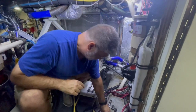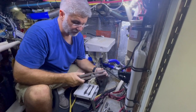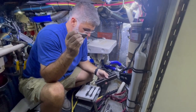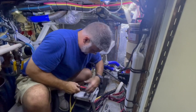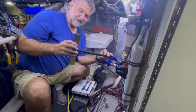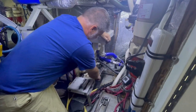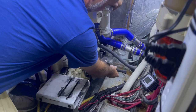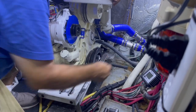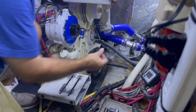The next step is this puller — I can give you a link to it. It is an OTC 522 gear and pulley puller. I'm going to take the bolts that held on the PTO, run them through this, and screw them into the front of the vibration dampener to hold it on. Then I have a center thread that goes in and pulls off the vibration dampener. I hand-screwed it in and moved it back and forth gently to make sure I was completely centered in the pilot hole inside the crankshaft, and I took a little WD-40 and sprayed it on the threads. I only have it hand tight now.